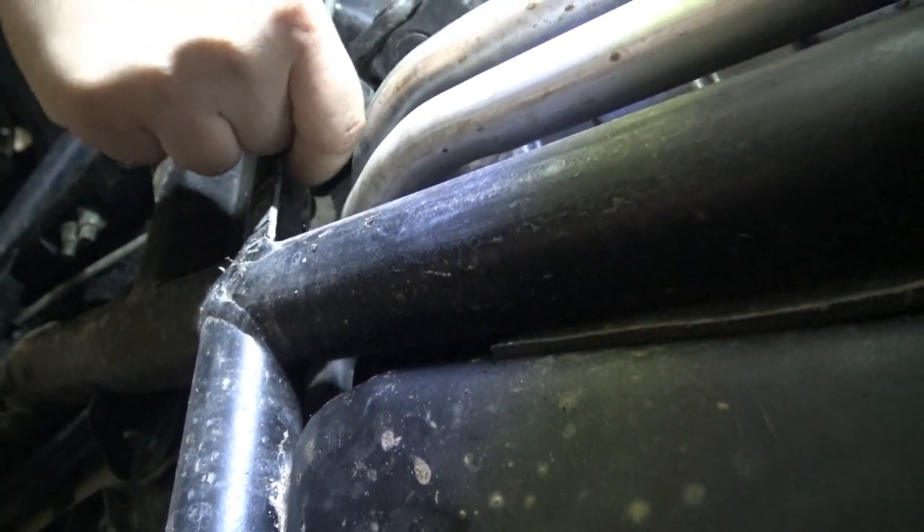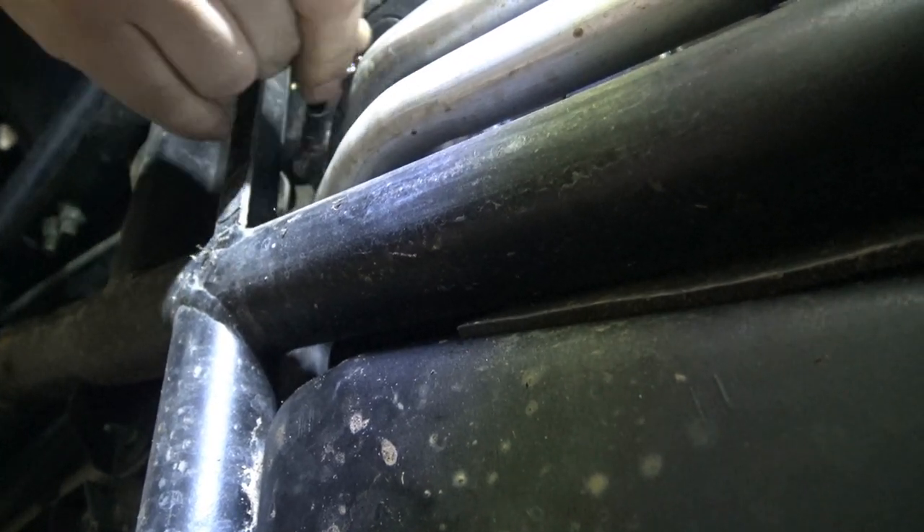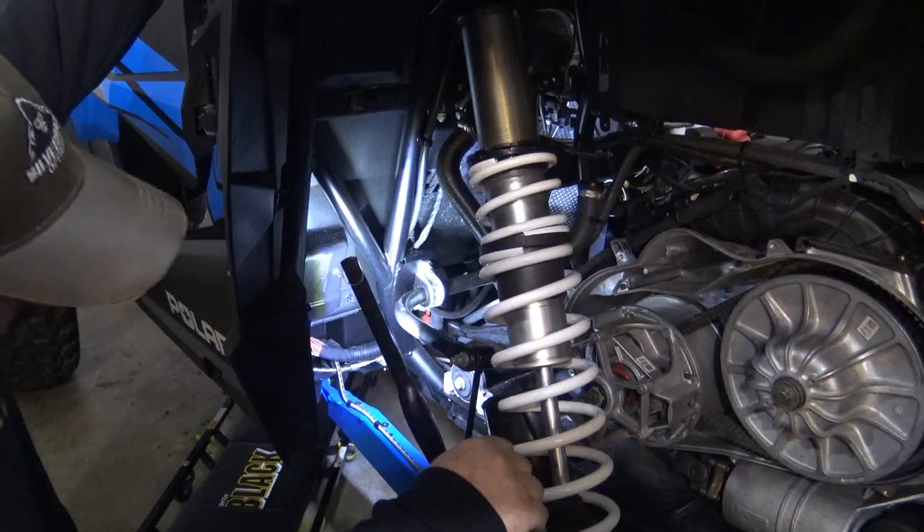This is just the sway bar — this machine doesn't have a whole lot of grease points. There are three: the two on the front sway bar, one on each side, and then one on your slip yoke in the middle of your driveshaft. There's one there and the rear sway bar can get squeaky and dry after you ride in trails and wash it. Pull this back belly pan and you can see right there by the carrier bearing — that's your grease point. Go ahead and shoot a little grease in there — maybe a couple squirts.